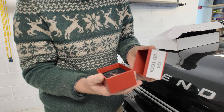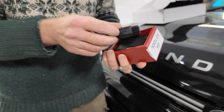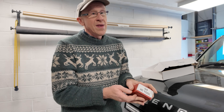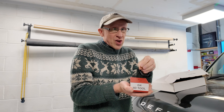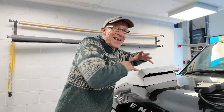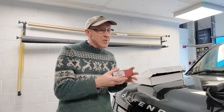This is our old favourite Gap Diagnostics IID tool. It's a little dongle that goes into your OBD2 port. There's an app on your phone, which is very convenient because you can take it with you everywhere. It will read fault codes and change your car configuration files — the CCF. The software for adaptive cruise control is already in the car; the hardware's on the car. It's just a setting that says it's available for you — you just need to toggle it.